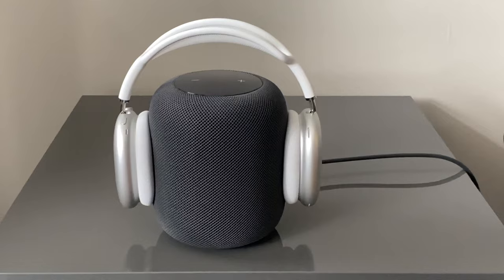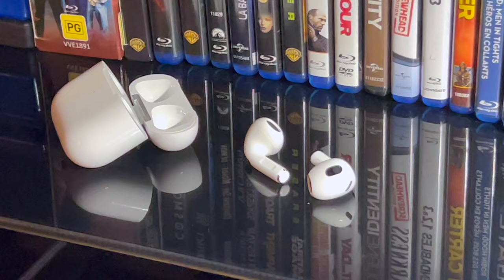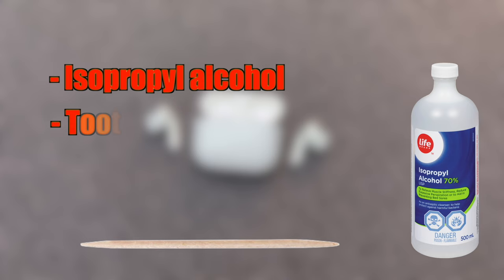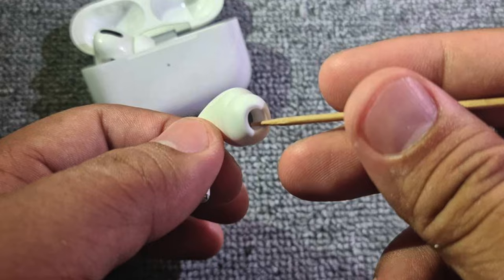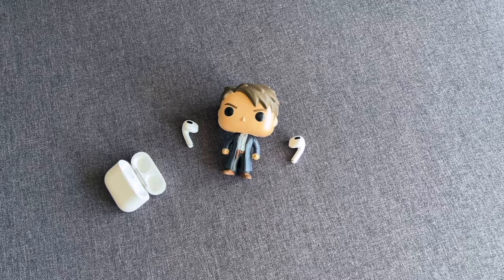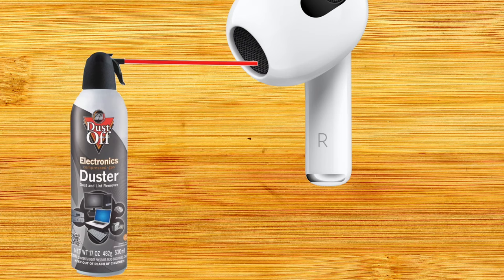If you still need to make your AirPods even louder, make sure that they are clean. Earwax and dirt buildup on the headphone speaker can cause your AirPods to be quieter or even muffled. The recommended way to clean your AirPods is to gather isopropyl alcohol, a toothpick, and an old toothbrush or some other type of small brush with soft bristles. Lightly spray the speaker mesh with a drop of isopropyl alcohol and leave it for a few seconds, then use the toothpick to pick out the dirt and debris from around the speaker mesh, then lightly brush the speaker mesh area with the old toothbrush. Repeat until all the dirt and debris is cleaned out. If you don't have isopropyl alcohol, spraying the speaker holes out with a can of compressed air can often work pretty well too.